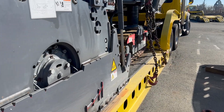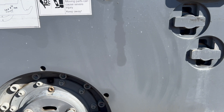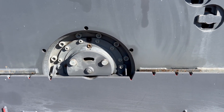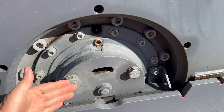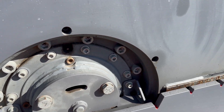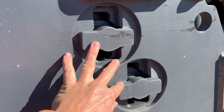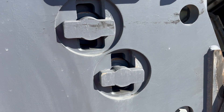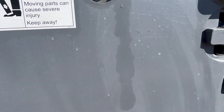I'll shoot a quick video showing how to tighten the side door when it starts working its way loose. If you look down from on top, you'll see this housing bouncing in and out. What's causing that is the cylinders on these two locks have backed their way off a little bit, which is allowing the door to be slightly loose and open and close.